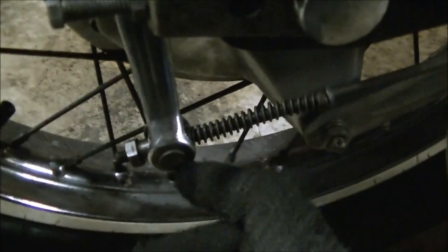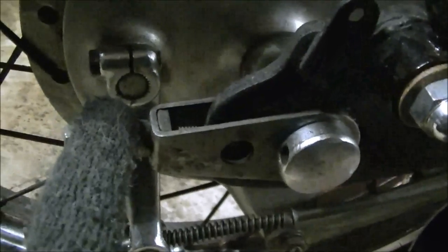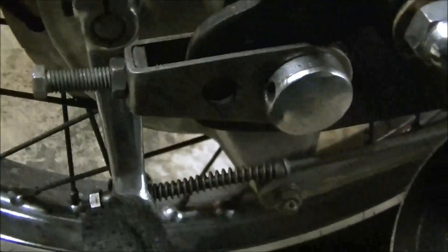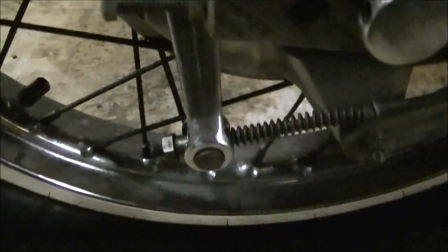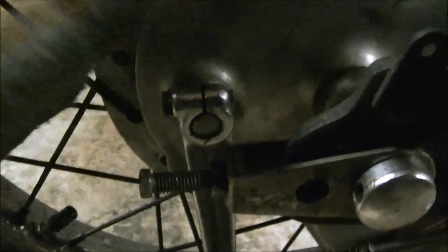The way to do that on this bike, there are two different ways. If your brake alignment is way out of whack or you have no idea where it is, you can actually take this entire lever arm off here and adjust it — change the starting angle. It goes on a spline here, and you could take it off the spline and change the angle if you can't get the adjustment you're looking for. So if your alignment is just way out of whack, you may need to take this entire arm off and start it at a different angle to get the pedal travel you're looking for.